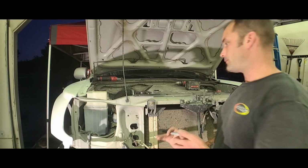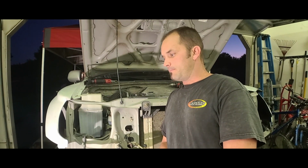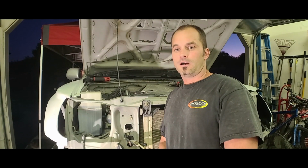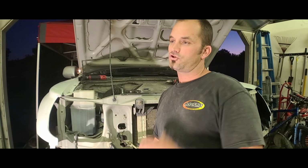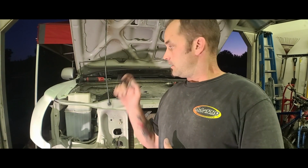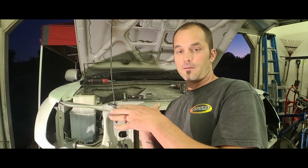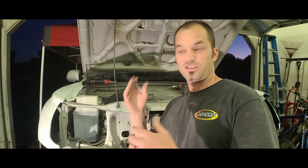So for now, I hope that was a fair amount of information for you guys. It is pretty simple, cut and dry. The main thing that I could say, personally being a fabricator and then this being my first time putting the McNeil front fenders on and then also installing the bed sides, is just take the extra time to get your fitment and placement correct. Even on this passenger side front fender, at the top where it meets the bottom of the windshield, there was an excessive amount of fiberglass and material, and instead of making small marks and just really digging into it, I took it little step by little step.